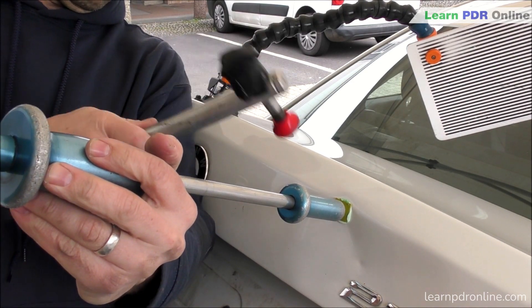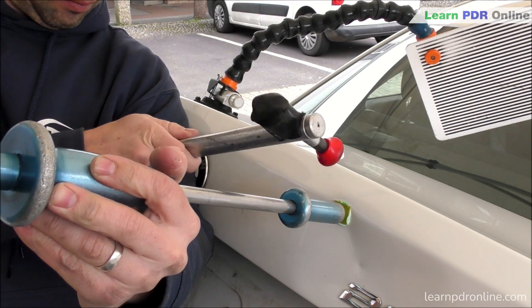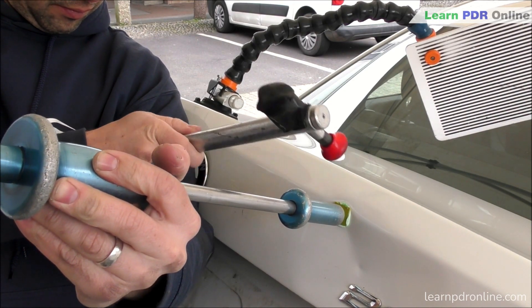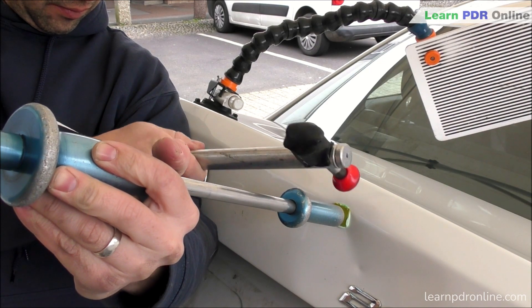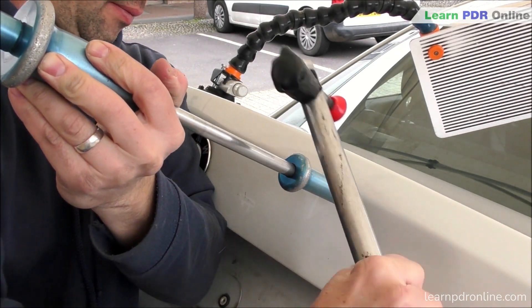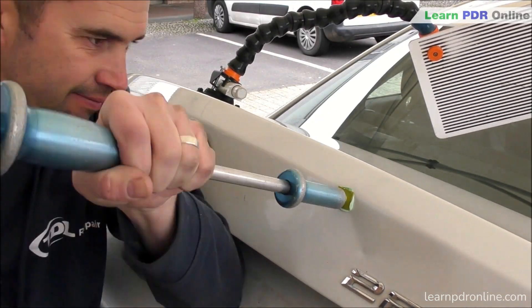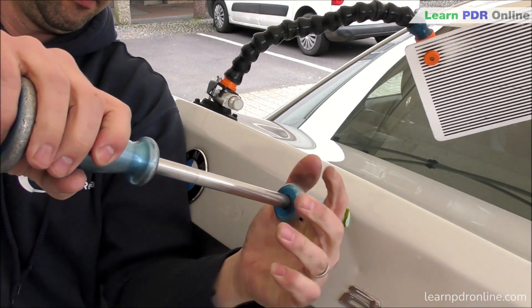Having this simultaneous movement makes a huge difference and it's all about metal flow. As the dent has pushed the metal in and up, I'm trying to reverse that process - applying pressure pulling my slide hammer to pull the dent out, whilst with my hammer I am tapping down the high spot to push that metal in. The impact went in and up; I'm trying to reverse that by pressing it down and out.